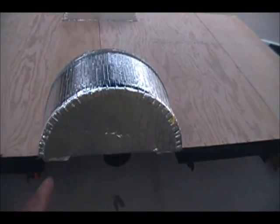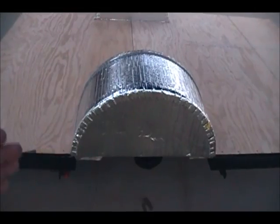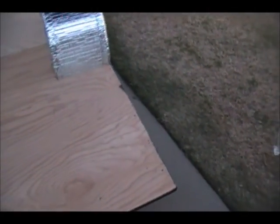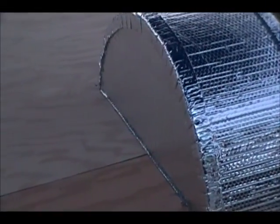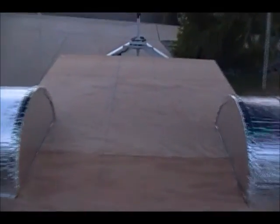In the last video I had put a wood frame that went across right there, then the fender well went on top of that wooden frame and I tacked it down. The plywood lays on top of it, sandwiching it in between the wooden frame and the plywood itself — the plywood sandwiches it and does not need to be screwed down along the back side of the fender well. Too many screws there would hit the metal frame and I wouldn't be able to get screws into that without self-tapping hardware. So what I have is the main row right down the middle and then screws all along the edge of the frame.